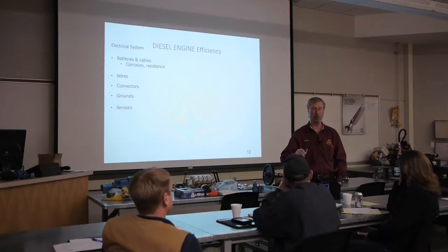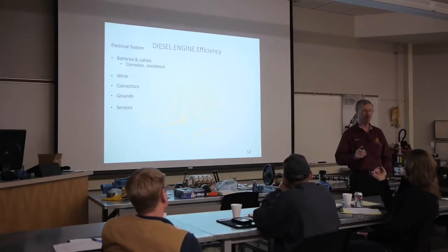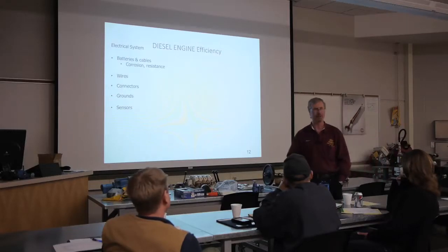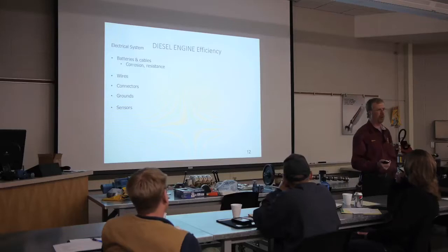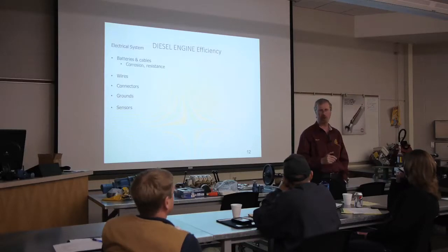And most of that is to do with fueling. All right? So your sensors, love them or hate them, they're not going away anytime soon. And some of them are getting very complex. The nice thing about the newer systems, probably 2006 and newer, is we have a system called a CAN bus, C-A-N, that is controller area network. And that is basically a two twisted wire backbone, which is connected to every single control module, ECU, whatever you want to call it, on that particular vehicle piece of equipment.